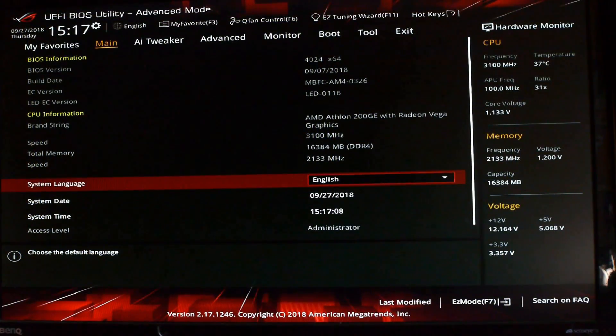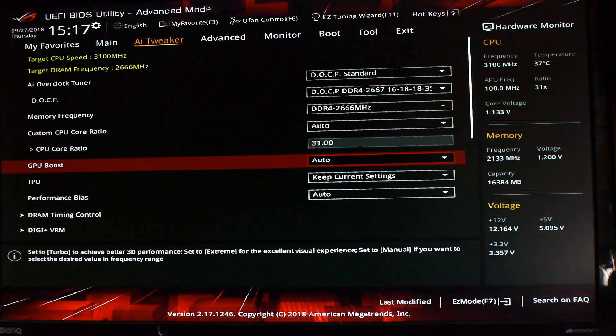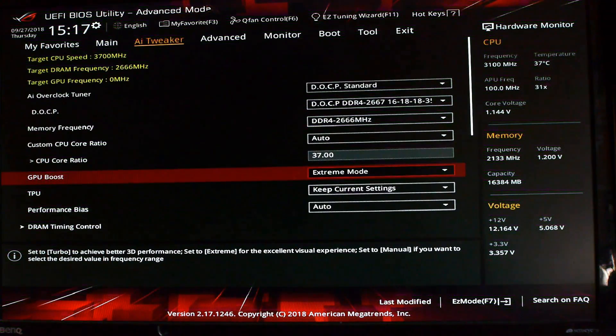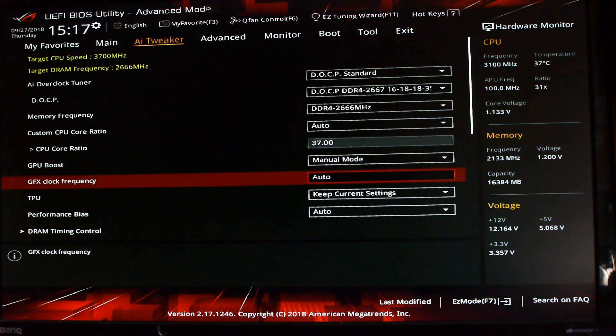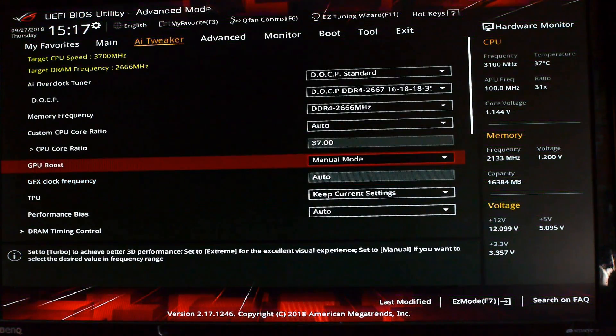My first thoughts for the APU weren't actually great — the APU really hates my main monitor. Apparently all APUs really do not like this Dell monitor when it comes to getting into the BIOS screen, due to incorrect timings and resolution, which is very odd considering the Dell's usual amazing legacy support. As soon as I switched to a different monitor, such as my BenQ one, we were able to get into the BIOS and things worked straight away, so that seems to be an issue on the Dell side.